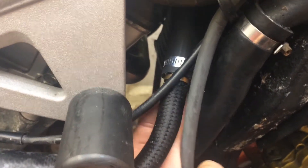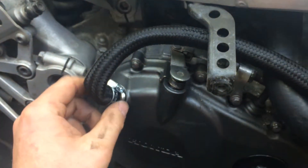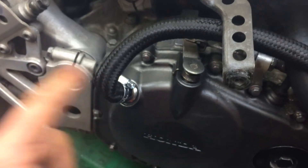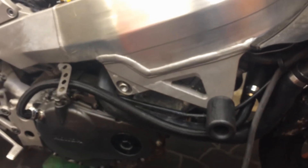The oil drain pipe is now on the bike with the turbo fitted back on. The pipe goes down over the top of the head, down behind the radiator. There's an adapter going from the 16mm pipe down to 12mm, which feeds around and ties up under there, going into the oil filler on the motor. The only problem is the pipe is kinking, so I'm going to have to swap it out for a stainless pipe to fix that kink.